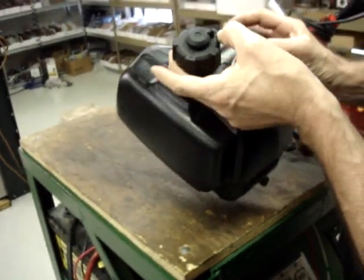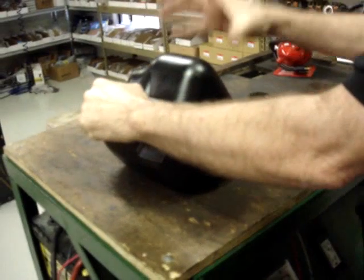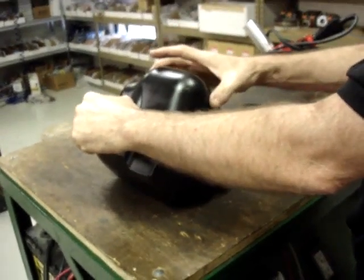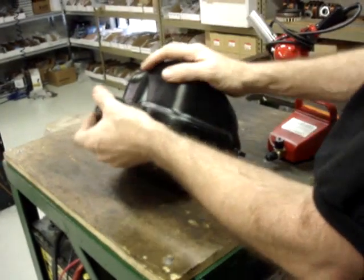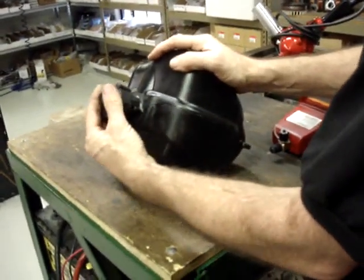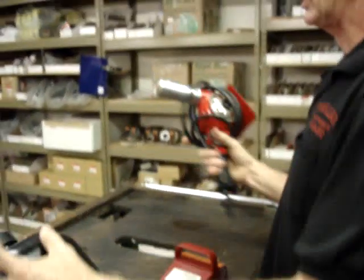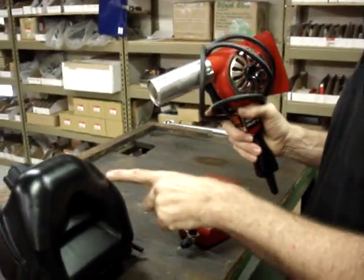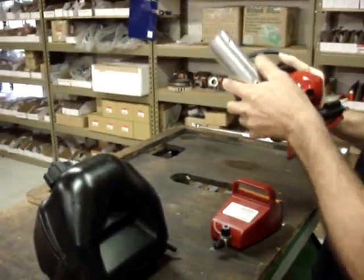When you move the vent to the off position, that closes the vent, which puts a tremendous amount of vacuum on the back of the tank or front of the tank. If it started to pull in too quickly, you'd start to open the vent. The whole time you're doing that, heat the tank with a Master Appliance heat gun or whatever kind of heat gun you have.